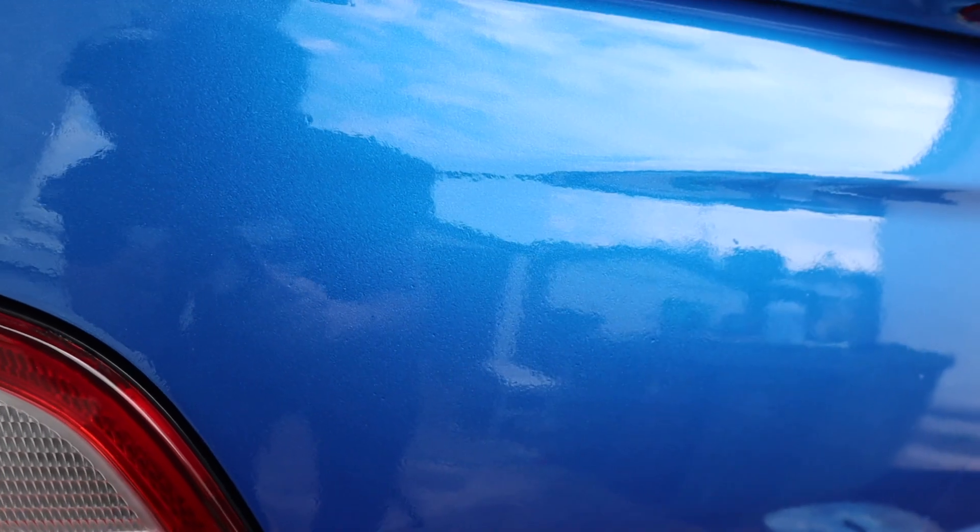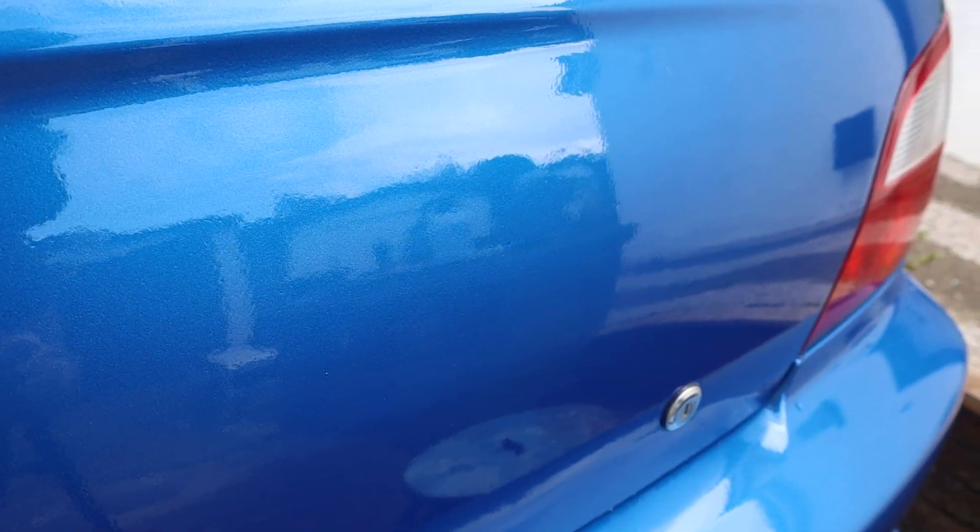This is what it looks like. If you look at the paint here you can see that the reflection is quite textured - it's not a glass-like reflection. Now I'm not a spray painter, I'm not a panel beater, so I can't go into depth about the exact cause of orange peel, but something to do with not enough pressure on your gun and holding it too far away from the finish is what I'm led to believe is one of the main causes. However, what I do know is how to get rid of it, and here's what we're going to do.